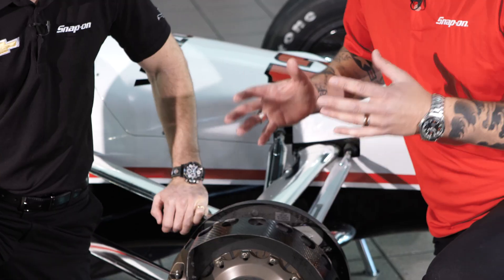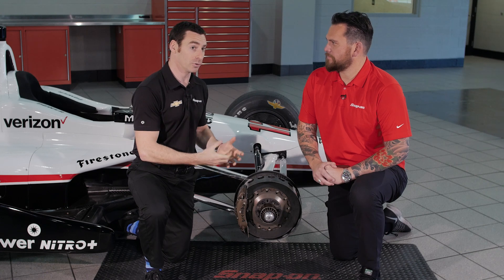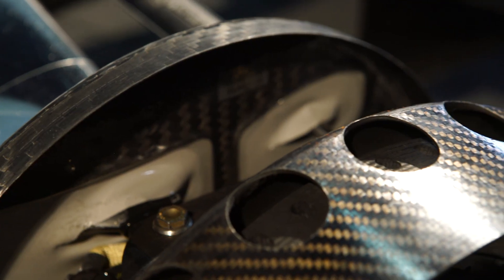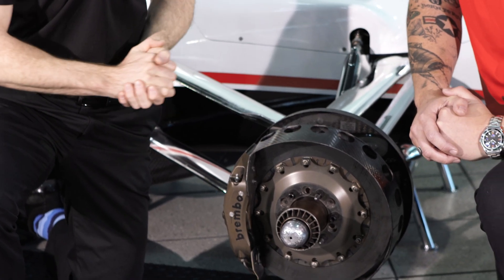Do you want them to be hot or cold? What are you looking for? If it's too cold, you don't have any bite on the brakes. If it's too hot, then the pedal gets longer and you don't have the right capacity of braking. It's a trick for the engineers to decide what they're going to do for the race before the race. We also have the brake ducts that help cooling. It very much depends on the racetrack and the temperature.